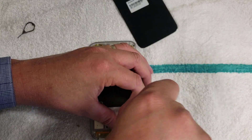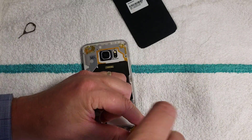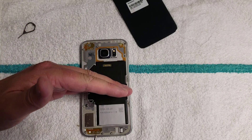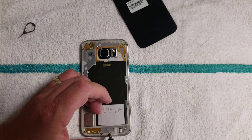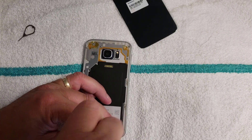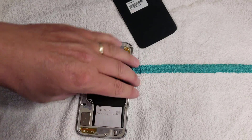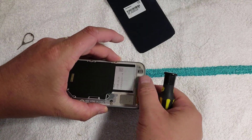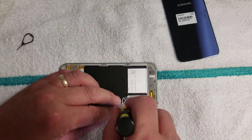Now, it's critical that when you put the screws in, if they're not in perfectly flat, you get them out. Start at one side and work your way around. Don't tighten them up all the way — tighten them loosely first, just get a few turns on them. The reason is, as small and tight as these things are, there are still tolerances. If you tighten up all the ones at the bottom really hard, you'll put a lot of pressure on the screen and might crack it. Also, the ones at the top might be off a hundredth of a millimeter and you might have trouble screwing them in. If any screw is not in flat, you need to get it out because this is glass and it will simply break when you try to reattach it.